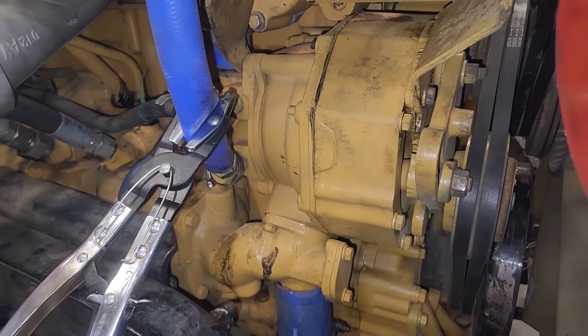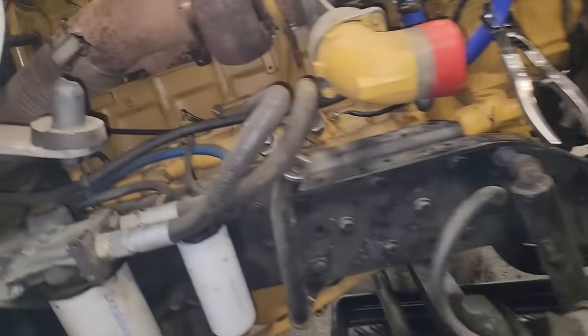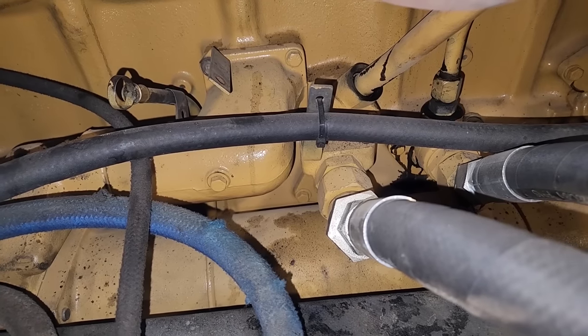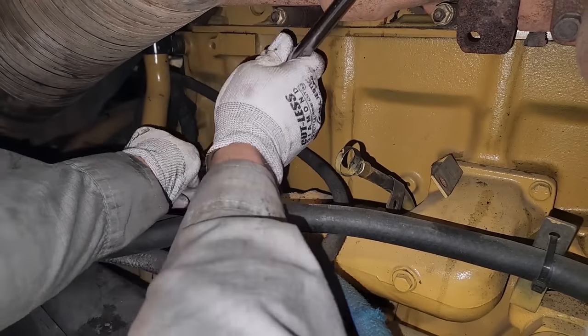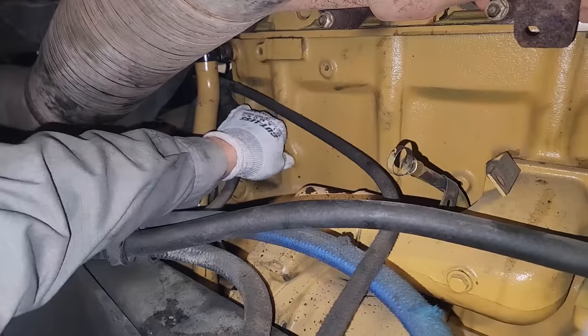No coolant coming out means the thermostat housing has no coolant in it. Not sure where the coolant is in this engine. I'm leery to pull the lower radiator hose because I don't want it to suddenly dump out. This is the inlet coolant to the block from the oil cooler — I want to see if there's coolant in the block itself. So we're going to pull this plug on the back of the block. This customer's driven the truck a couple hundred miles since it was rebuilt, and it's been running hot ever since — up to almost 230, maybe higher. Definitely way too hot. If there's no coolant in the block after running that hot, this engine's probably toast. But hopefully there's coolant.